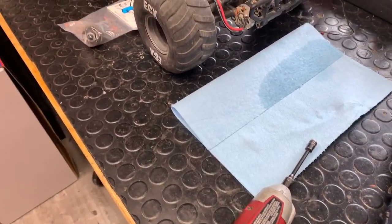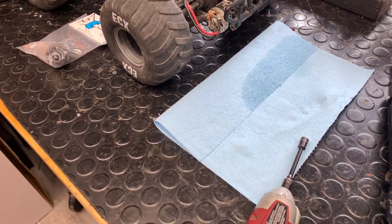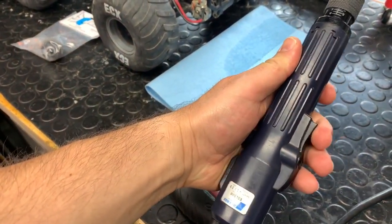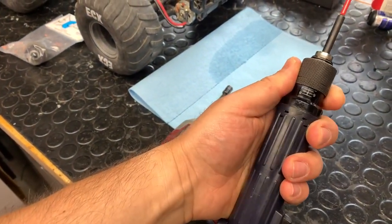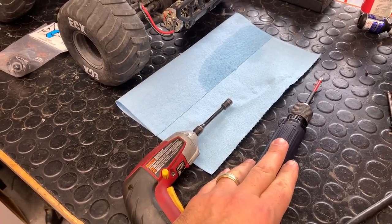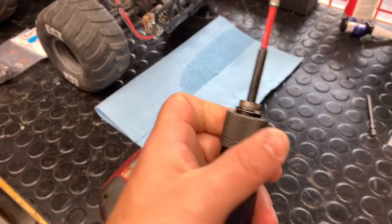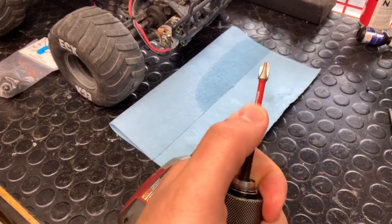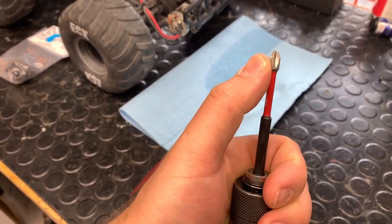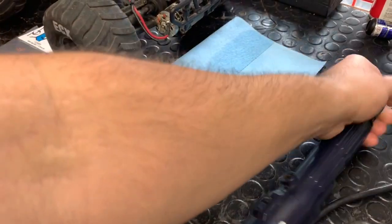Now, we're using power tools because we're proficient. We've done thousands of repairs. We know what's up. We use this Delta Regis tool. It's a stick driver, which worked great, but it has an adjustable torque on it, so we really don't have to worry about breaking anything. It can happen, but it is very, very rare, okay? As far as bits, for Phillips number 2, we really like these Milwaukee Shockwave bits. They work great. They're really low profile. They fit in a lot of holes, which is good. And they're nice ground tips. They actually work really good.